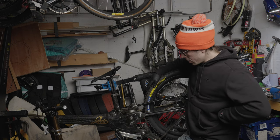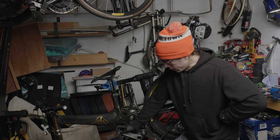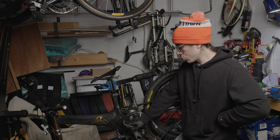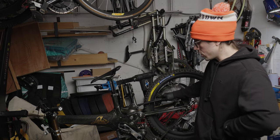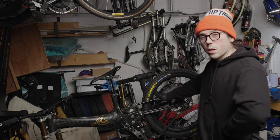That's the bike back together. Fixed all the issues, fixed the mounts, changed all the tie bolts that hadn't been done. Had to space the cranks out a little bit because they were very tight to the frame — the bottom bracket's in quite a bit and it curves out so you can end up getting a frame strike. It was just striking the new bolts I've installed. That's the bike totally finished now, and hopefully it'll be ready for the trails.